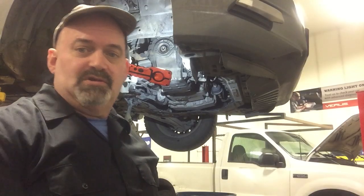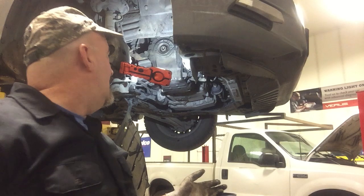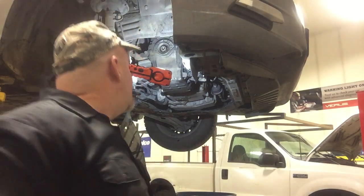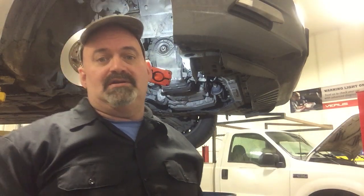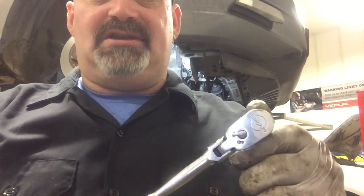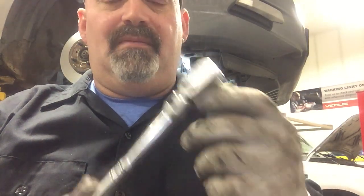All right, we're supposed to torque these bolts, of course, but I'm not going to BS anybody. I don't know that I can get my torque wrench in there. I suppose I could get some of them with the torque wrench, but my torque wrench ain't going to fit. So just get them nice and tight with your 1/4-inch drive wobbly head, long handled ratchet with your short 10 mil 6-point socket. This would be a real handy tool for this job.